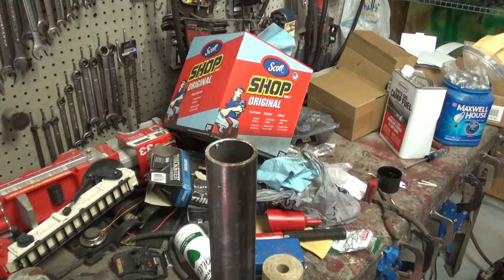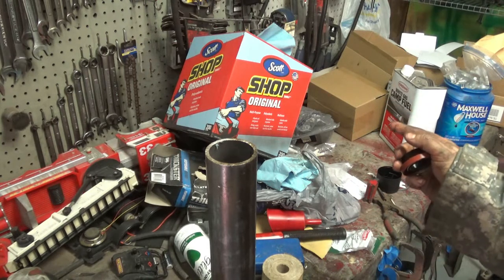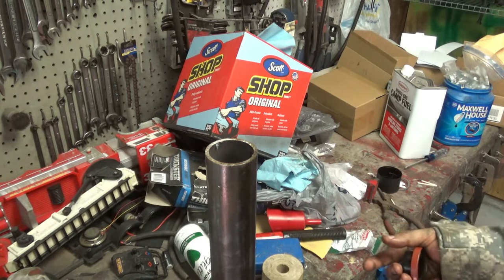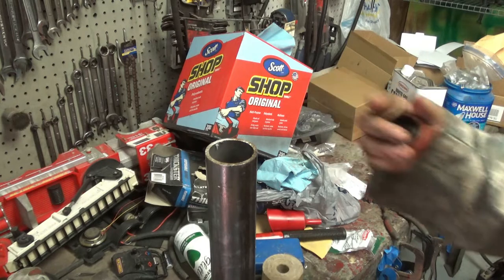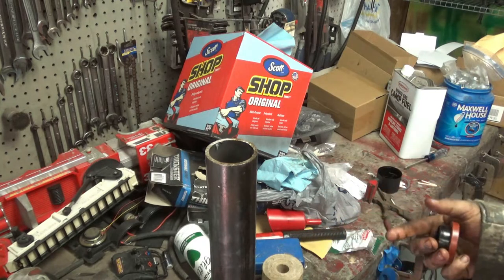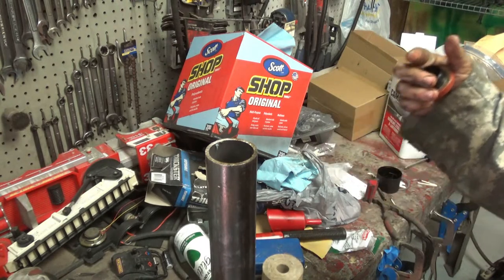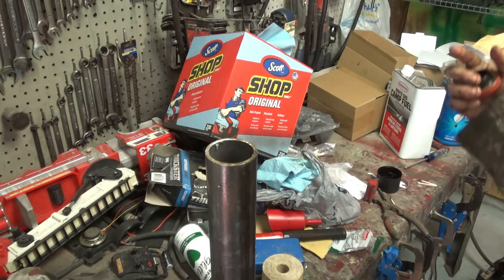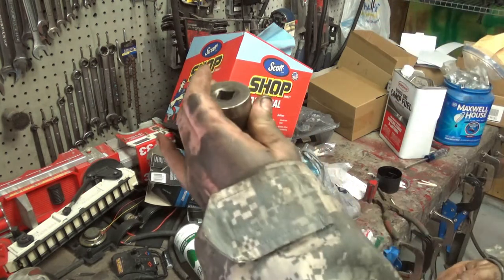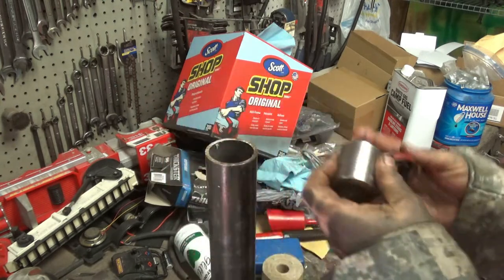Pardon my air compressor. But what I came up with was to connect, and it's the wrong use for all the right tools, most of my half-inch extensions together. And that gives me enough length to get from the long side, which on a Dodge would be the driver's side, from one end of the axle to the other, and get it poked in where I could probably stick a socket onto it and then pound the other side.